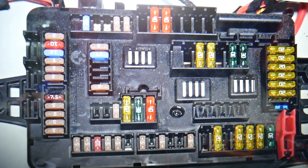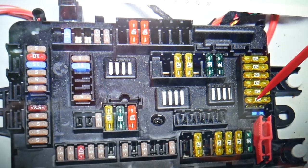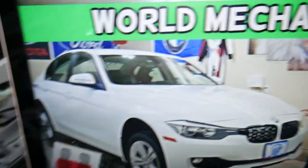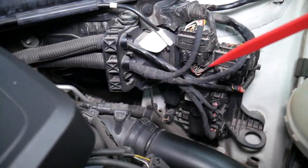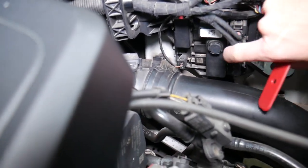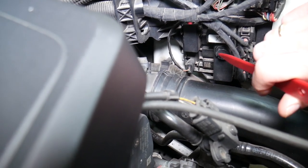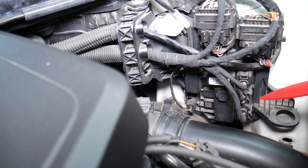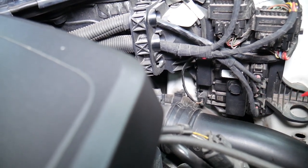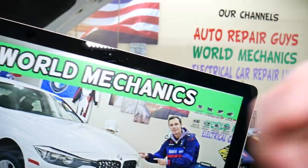You also need to check fuse number 165, which is a 20-amp fuse. There's another fuse for the fuel rail pressure sensor, which is part of the fuel system and fuel injection system. On the driver's side by the shock tower, you have one electrical box, and in that vertical part you will have five built-in fuses. The first fuse on top is for the fuel rail pressure sensor. To check or replace those fuses, it's a sealed box, so you have to replace the whole assembly — though we've seen people cut it open, replace the fuse, and seal it back together. We'll be making a video on how to do that. Hopefully this video was helpful — thank you for watching and see you next time.